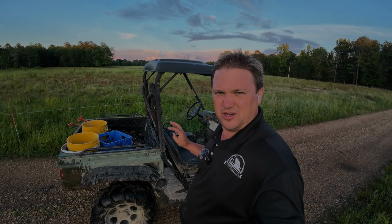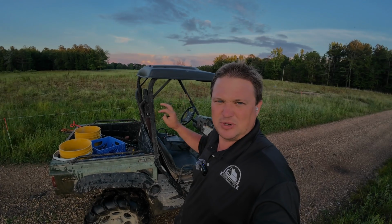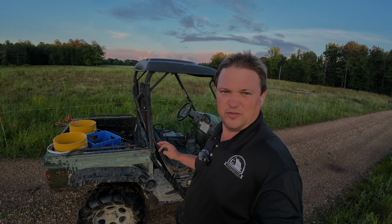I should be less than an hour from getting done, and I have just made a royal mistake. Hey, it's Rob from Dowdle Family Farms, and I'm going to try to do some work on the Rhino here. It was starting to have some problems when you put it in gear, not accelerating real well, also driving down the road. It felt like it was bogging down. The speed would slow real dramatically, like you let off the accelerator.